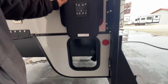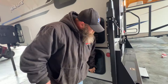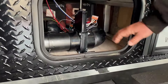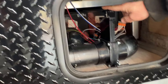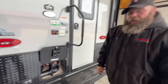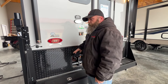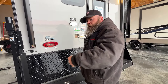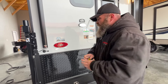This here is where you would open up to hook up your sewer hose and then dump. Your valve for that is going to be located right over here underneath this compartment door. You've got your black handle for the black tank and then the gray handle for your gray tank. Whenever you go to dump, it is always recommended you do black first, then close it, and then do your gray. This unit does not have the black tank flush on it, so it's recommended to maybe get a wand to stick in there to help clean that tank out.